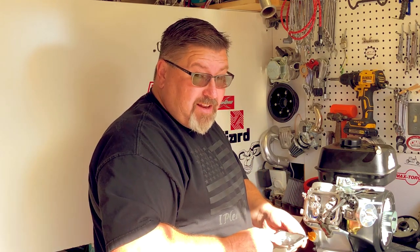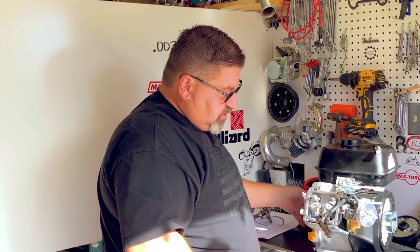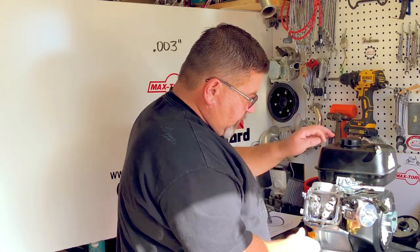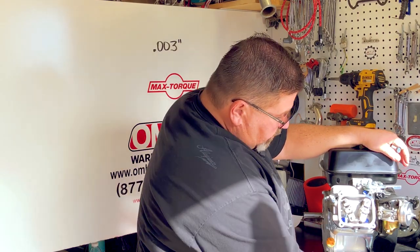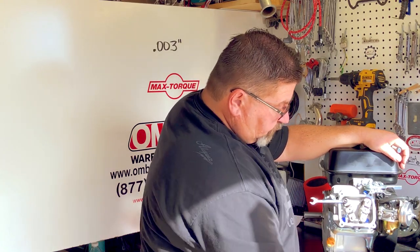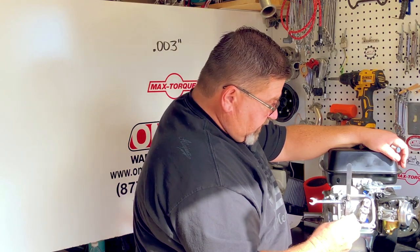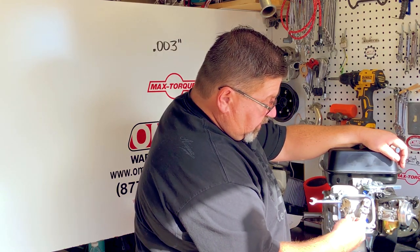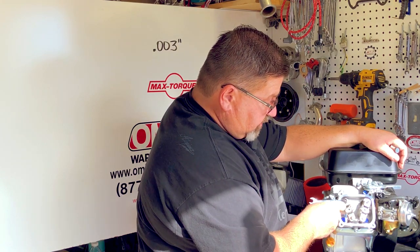We're not going to reuse this gasket. Gaskets are very important — once compressed, it's compressed for good. You should always use a new gasket. It's $2 well spent. Here we have the hemi head with the rocker arms. What you're going to need is a 9mm wrench and a .003 — that's three thousandths of an inch — feeler gauge. For the adjuster itself, you can use a little crescent wrench on the square knob on top.